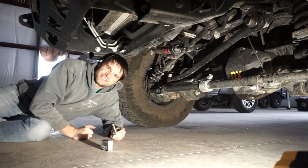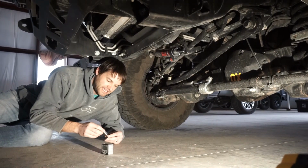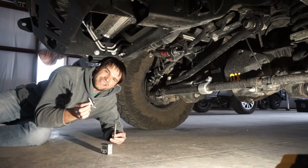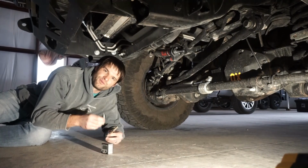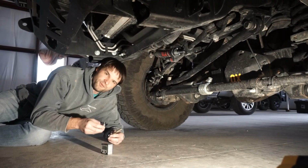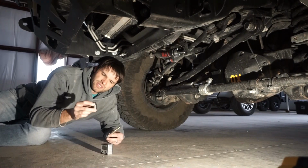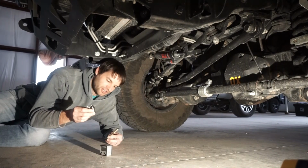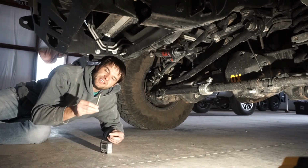And I had talked to Fox about designing a little drop bracket or whatnot for that frame side of the shock, and they did. I will put a link in the description below, but you can get this little drop and the bolt for free from Fox. But it basically is a machined, looks like steel or aluminum spacer that will drop that frame mount down by a good 1.25 inches, and a new nice, looks like grade 10 bolt to secure it.